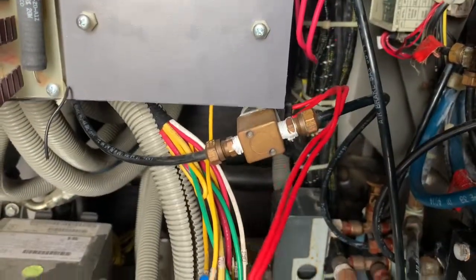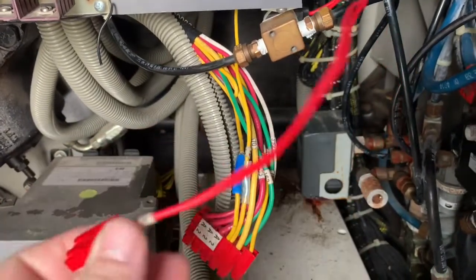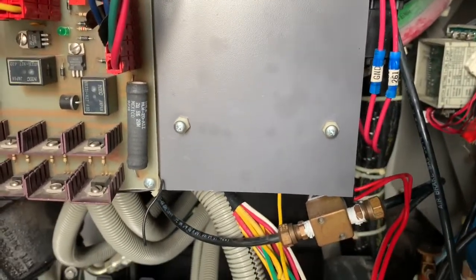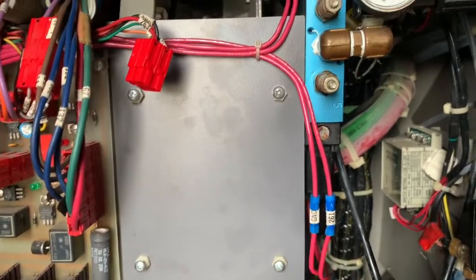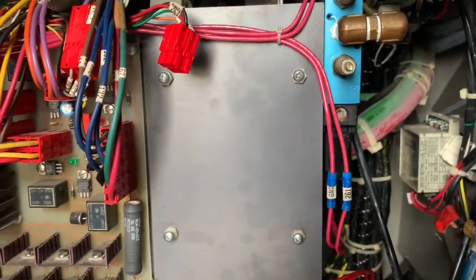And I thought, I wonder if that's for the air horn. So I connected a battery to the two terminals, and wow, those air horns are loud. So I can also put a relay in to power that. It also turns out that the mirrors are powered off that ignition relay as well. So 3 critical components I want to have working, all very easy to manufacture a board for, no big deal.